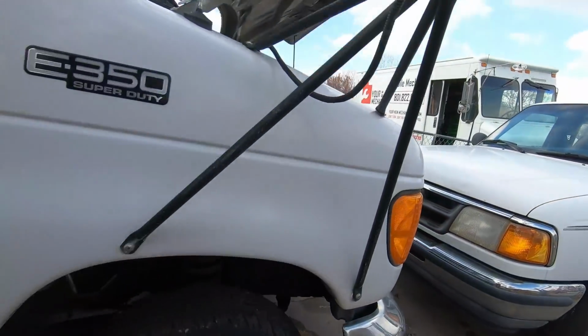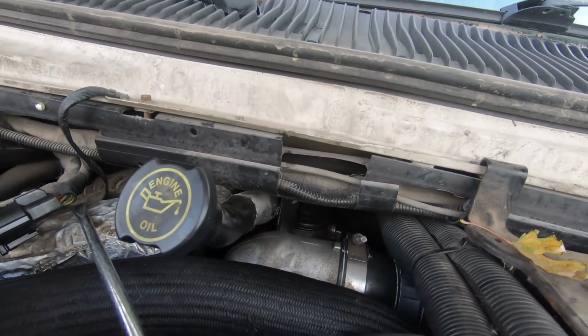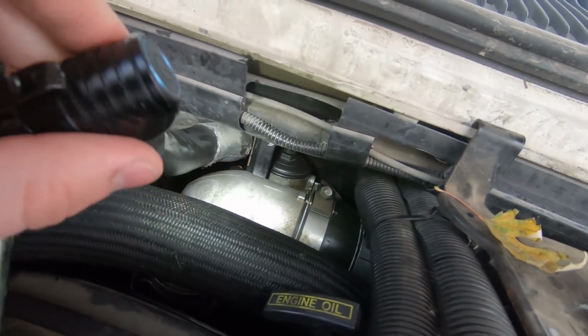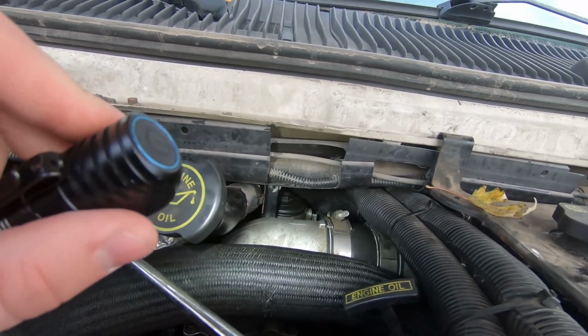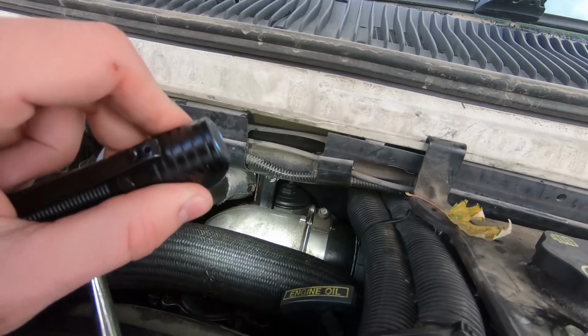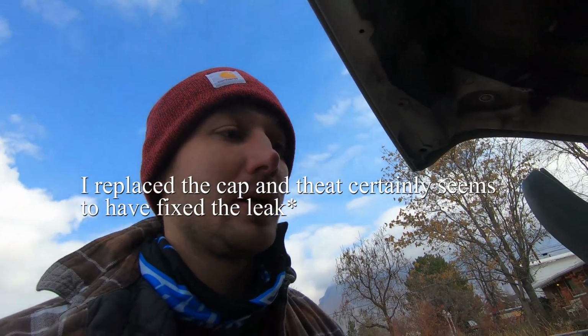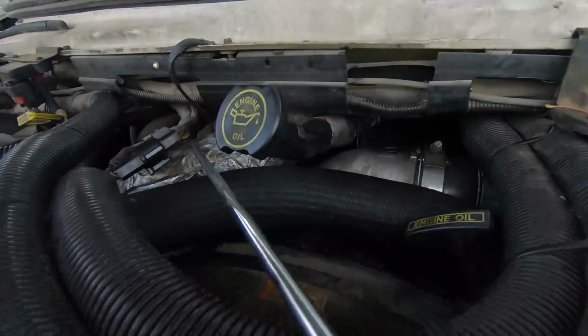I've also ordered a fuel filter cap. There are 2 fuel filters. And if you can see from the puddle underneath the bus here, it has been leaking when I charge up and prime the fuel system. You can see the filter there. The filter housing's nice and clean. There's a pinhole, and fuel keeps squirting out of that pinhole. So we think it probably has a cracked cap, since I already replaced the O-ring on that, and it's still doing it. If you know about that, let me know what exactly that might be all about. If that's normal and it's relieving pressure, I doubt it, because there's so much coming out. It's probably a cracked cap. Hopefully it's not that housing.